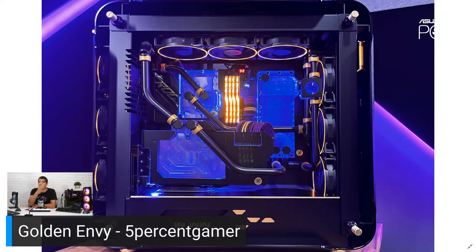It doesn't matter whether you bought the Dash E, whether you bought the Maximus Extreme. The Apex could have a little bit of an edge just because the DRAM topology is a little bit more tight because it's only a 2 DIMM based board, but overall, it doesn't really matter on the board. Even everything down to our Z690-PR entry have been validated for 6000 MT. It really comes down to, again, the quality of the IMC, which there's no way for you to guarantee. So the best thing I can tell you is that you can be confident. We have the best overall memory interoperability and compatibility in the industry, and I feel pretty confident that you're going to be able to run the memory that you want.